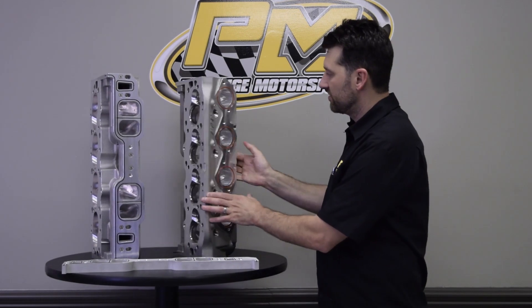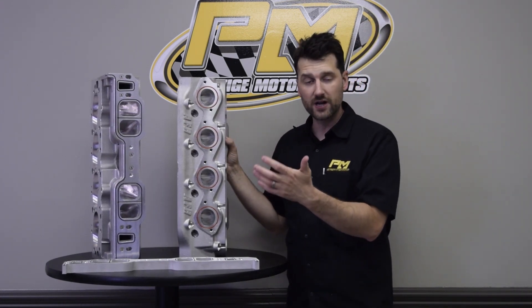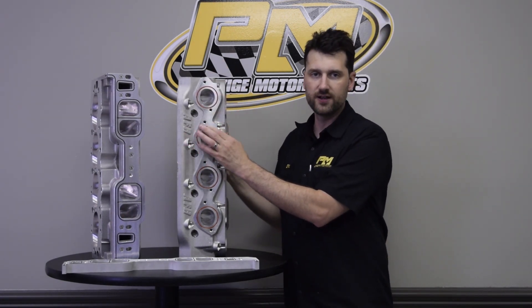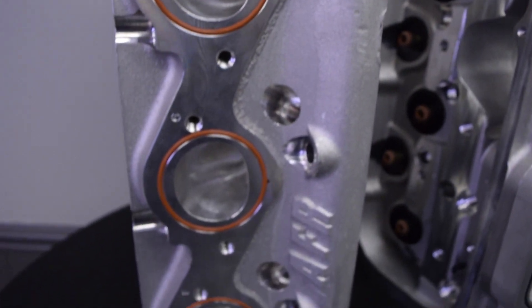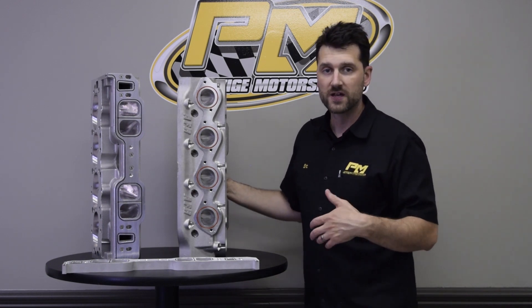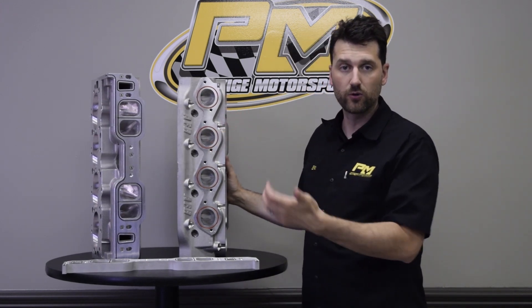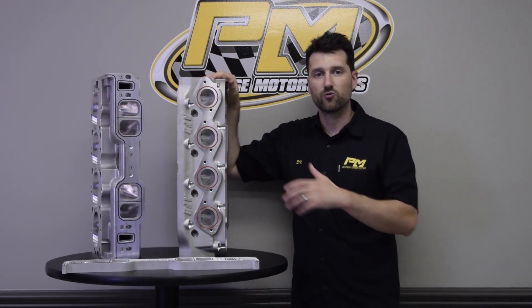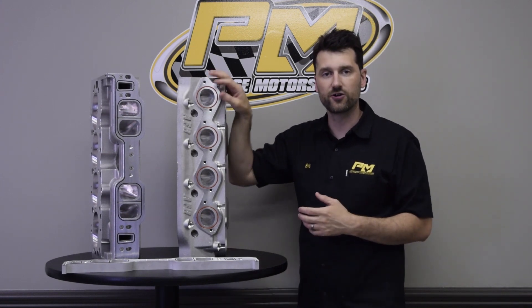You can also see that we added o-rings to the exhaust flange as well. What this does is allow us to have more of a metal-to-metal contact between the header flange and the cylinder head flange — all you're doing is compressing the o-ring in between the two. If you use a composite gasket, this particular combination is going in an airboat, so you're out on the water. Over time that composite gasket will begin to squish in different ways and allow the torque setting on those bolts to loosen up, ultimately giving you an exhaust leak. With metal-to-metal contact, there's nothing being squished in between, so you have a much lower chance of losing the torque setting on your header bolts.